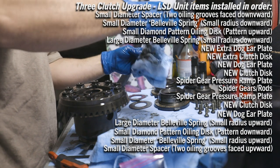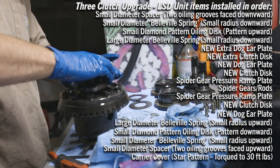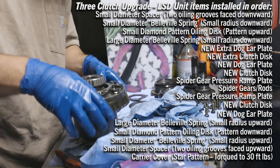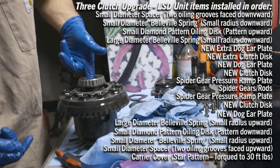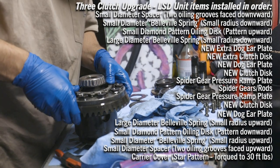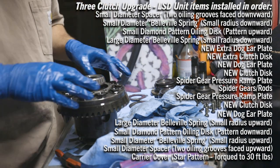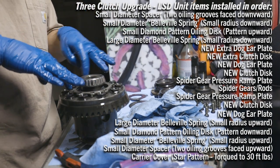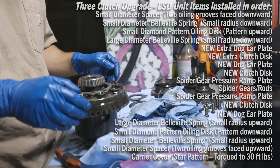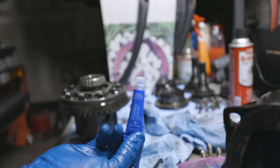We have our cover. Putting the carrier cover back down. I just kind of had to line those top discs up so everything - the oil groove and the spring, all those three little pieces lined up - and then push it down. It went really slow, really tight, but I think it's about as close as it needs to be. Now I'm putting all the new Allen nuts in with medium Loctite and then going in a star pattern to suck it all down, then torque to 30 foot-pounds. We're going to put eight of these in with some medium Permatex thread locker.